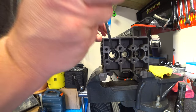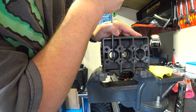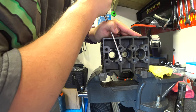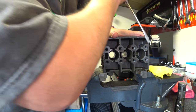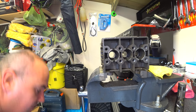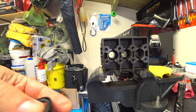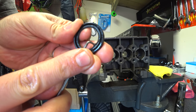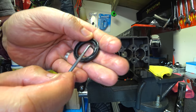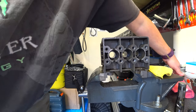Let's just see. One, two, three. Obviously once you've levered the seals out, the chances are you're going to have busted them. Sometimes there are little springs inside the seals - a tiny spring - so when you start levering on stuff you end up breaking them. There's two, there's three. Make sure you've got all your old parts and keep them away from your new parts.